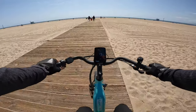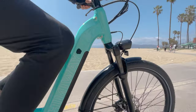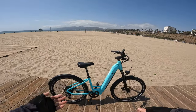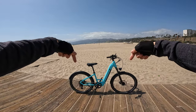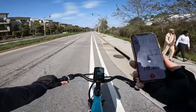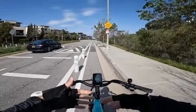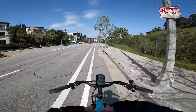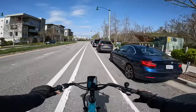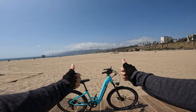It's a little harsh on the boardwalk — if you want a bike for riding here, you'd probably want full suspension. Heading home now for the final range summary. This is a commuter-friendly bike — not exhilarating, but it has decent range and decent power. It can handle decent hills and it's easy to get on. Back home at 18 miles on the odometer with two bars remaining — pretty much what you'd expect from a 15 amp-hour 48-volt battery. Riding mostly on thumb throttle near 20 mph at 200 pounds, you won't get 55 miles, but with pedal assistance you certainly could. Realistically I'd expect 30 to maybe 40 miles. Thanks for watching — give me a thumbs up, drop a comment, catch you next time.